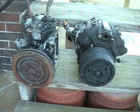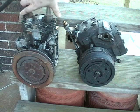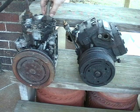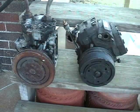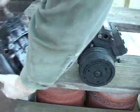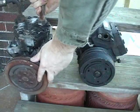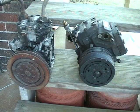If you want air conditioning and don't want to install an electric air compressor, you can use a belt-driven compressor. Right here is a York 210 — I removed this from an old Ford car. The 210 is the compressor you usually want; it's the one that most people use for their builds. It has a V-belt clutch, which you can replace with a serpentine for easier installation, and it can be mounted upright or at an angle. The 210 is usually the easiest air compressor to find — you can get them on eBay or from your local junkyard for about 30 bucks.